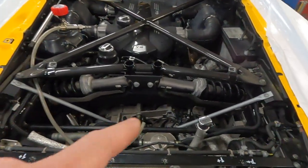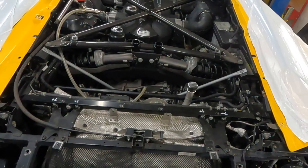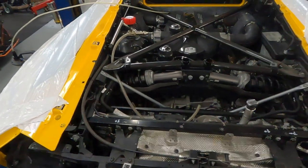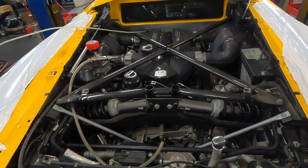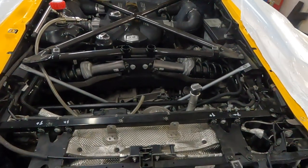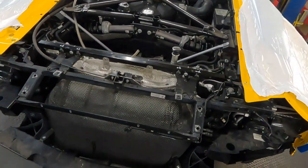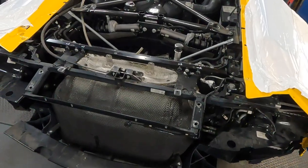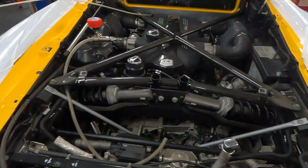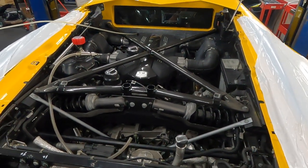We fill engine oil, coolant, still just to check the vacuum. Everything holds vacuum, about 10-15 minutes is good. Now our goal is to bleed the system. I mean, you guys, it's easy to pull the engine out, you can easily install it, but I think the more important things are the bleeding procedure and all the adaptation for this gearbox and for this clutch replacement.